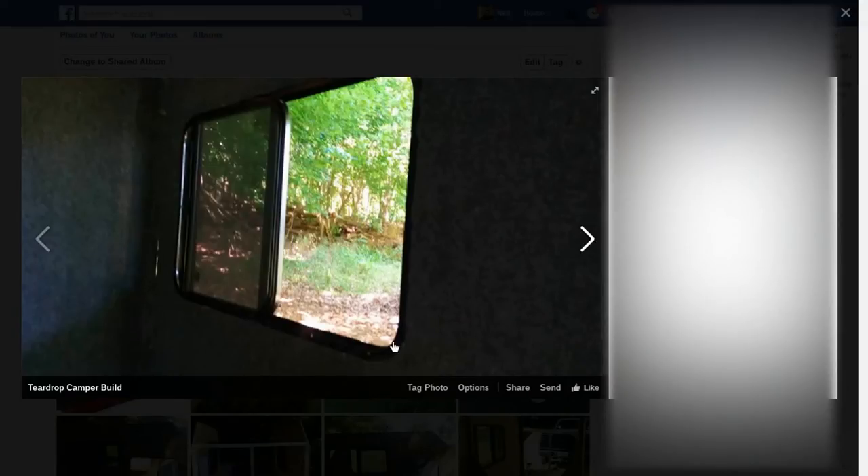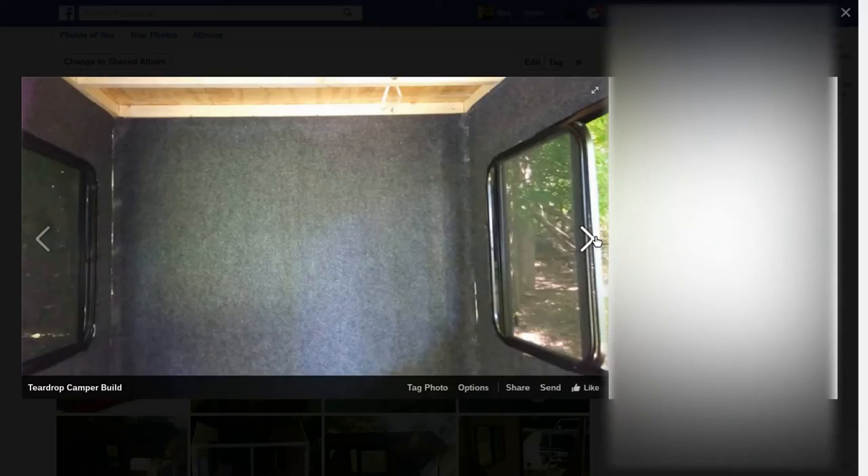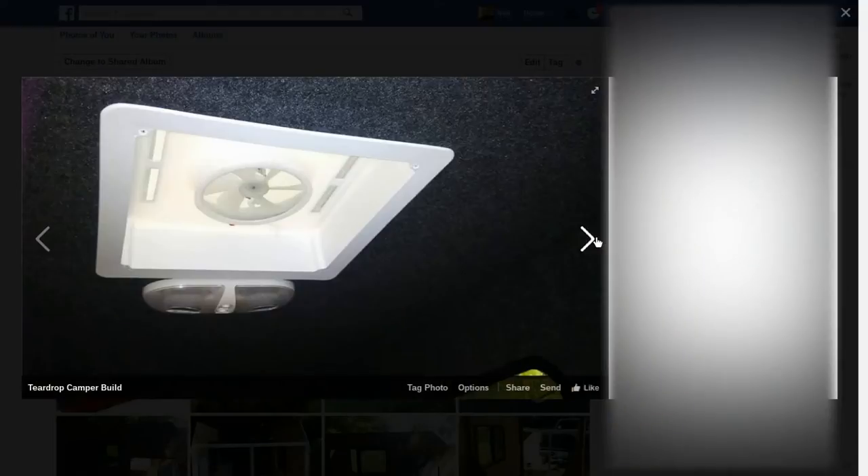My windows did not come with trim pieces, so I had to go another way. I cut out the acoustic carpet — the boombox carpet — and tucked it in around the windows, then went around with black caulk all the way around. In the corners where some insulation was showing through, I did the same thing with black caulk and was very careful with it. That sealed up the edges. I did the ceiling the same way. It's two years old now, still going strong, and it looks like a very professional quality install.